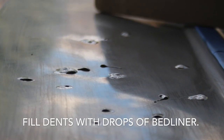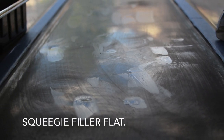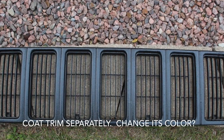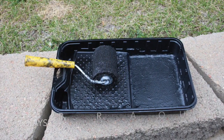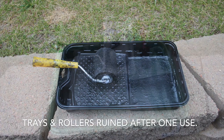For repairing moderate damage, you can take the liner, drop it into the dents, and then squeegee it — that squeegee thing in the background there. When you squeegee it flat, you've basically done what you would have done with Bondo if you were doing bodywork. Finish all your bodywork however you're going to do that, and then start rolling. You can roll the trim parts separately, and you can see it came out textured just like the car. Whatever you touch with bed liner is going to be ruined, so the rollers are trash as soon as they harden.